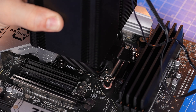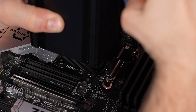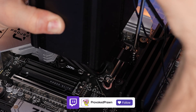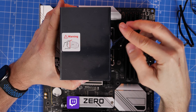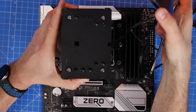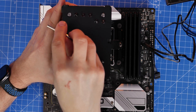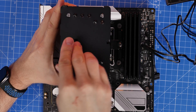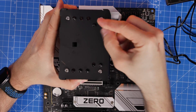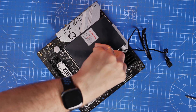You'll need to put the longer screwdriver that came with the cooler through the middle of the cooler to reach the screw on the left-hand side. Notch the right one a couple of turns, then go through the middle and repeat — go back and forth between the two, tightening as you go. I found I had to get down low to see the screw and make sure the tool was connecting up with it properly and sitting on the bracketing so it would tighten up correctly.